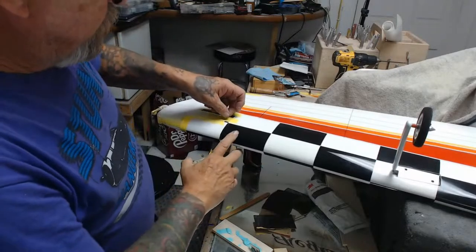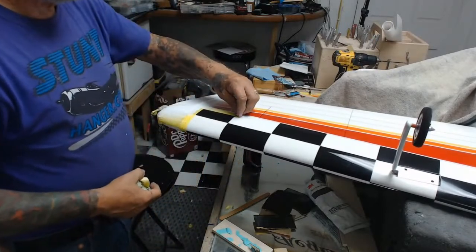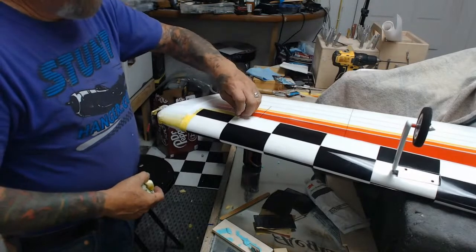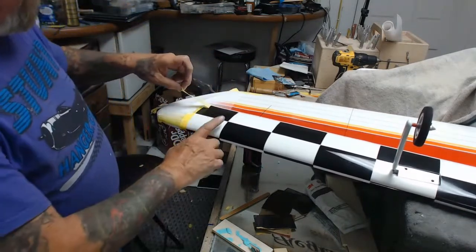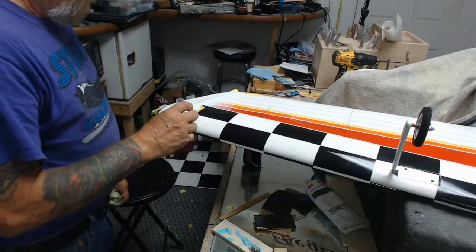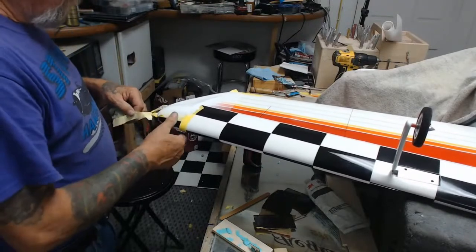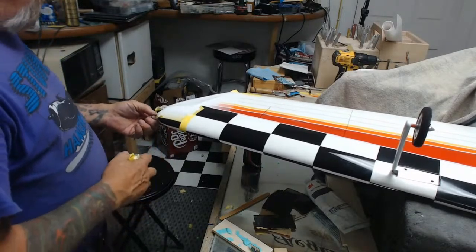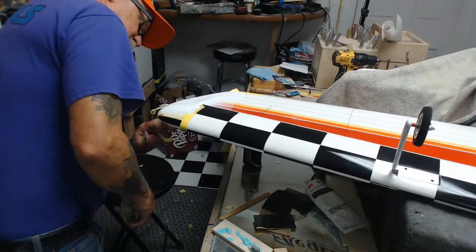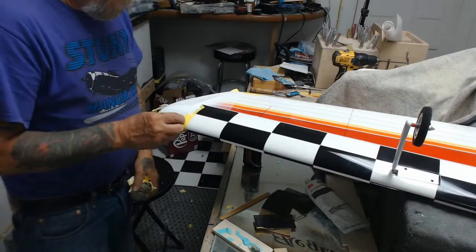The body shop, on a collision repair, will go to a body line or a paint line. Well, that's the same thing I'm doing here. And then they use a blending agent, but urethane is different. Urethane does not blend. You'll have overspray no matter what. I won't have any overspray on this. Now you can shoot it with straight thinner too if you can't get it to blend right. Not recommended, because you can melt your airplane, but you can do it if you're good.